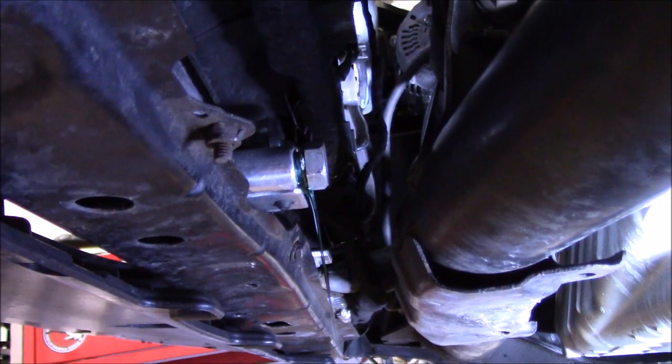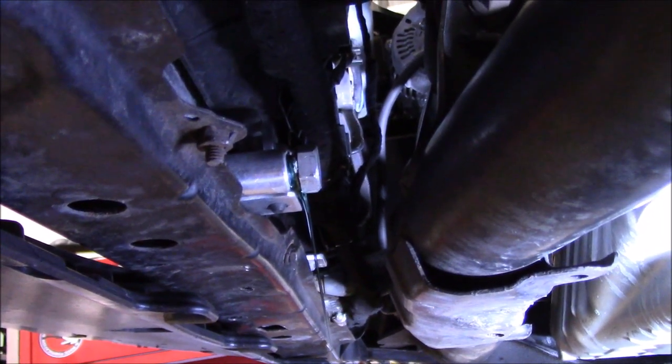To start off, I began draining the coolant. After that was done draining, I took the radiator hose off and I took that little hose off the bottom — the upper radiator hose coolant thing, I don't know what it's called — took those hoses off.